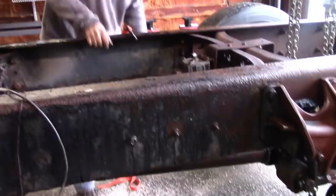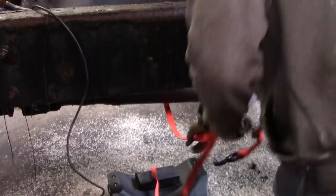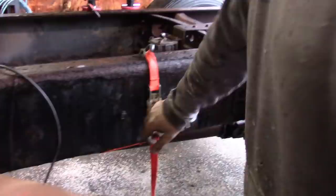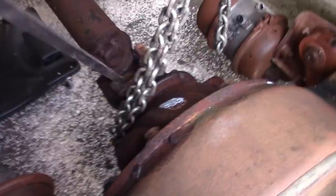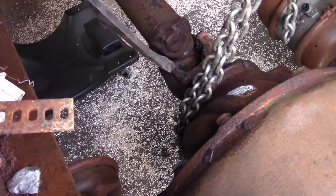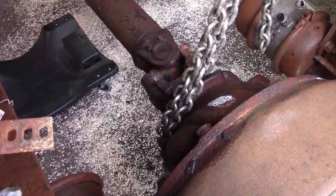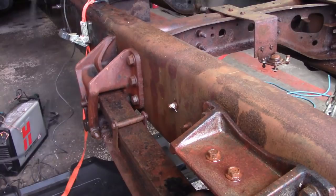These came out really nice. It was hot enough to melt the thread locker — I didn't have to heat them up — but it wasn't too awfully hot, because there's still some grease in the U-joint. I'm throwing a strap across here so when I pop this drive shaft loose, it doesn't slam down and hit the ground. I don't want to dent the drive shaft, because a dent will not only make it out of balance but give it a weak spot. I can't slide the drive shaft too far forward because the boot over the slip yoke joint got hot and it's kind of crunchy — not burnt off, but it's not going to let it flex — so I take the clamps loose and cut the boot off so I can slide it back and forth.